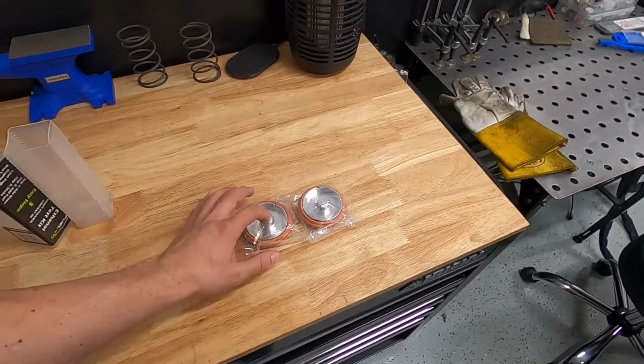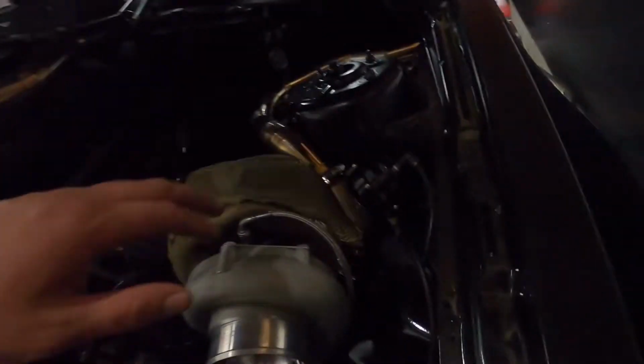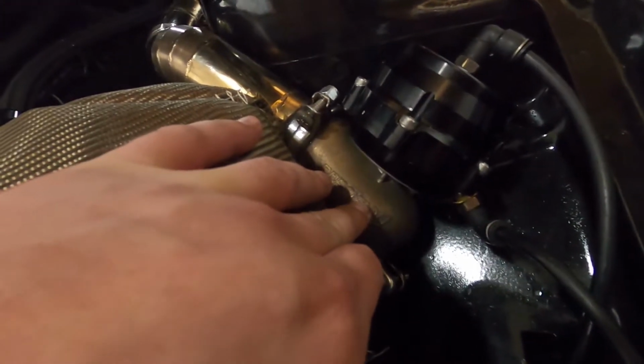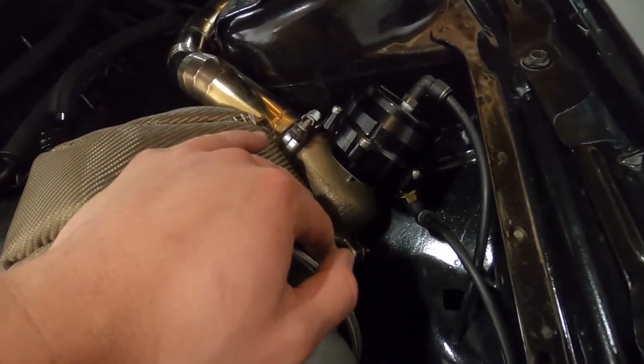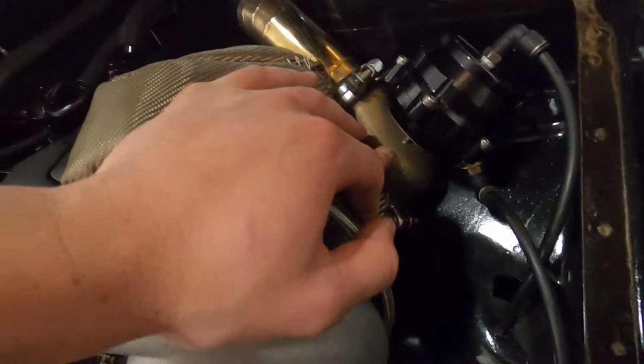So we're gonna just replace both diaphragms, maybe put a little bit of anti-seize on the valve stems, see how they look, and maybe put the high temperature silver anti-seize on there. We're gonna get started, pull these off the car now, and then do a little bit of rebuild and refresh. They're looking a little bit dingy, a little sad, so we're not going to polish them up, but we're gonna give them some color, maybe some shiny gold instead of doo-doo brown. But we'll get to it here quick.